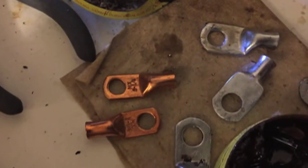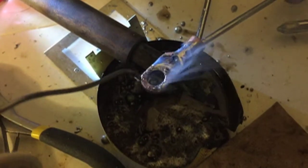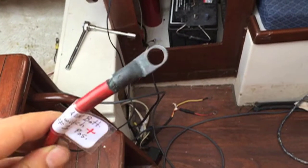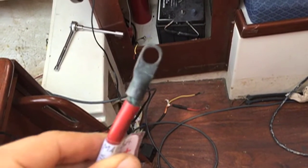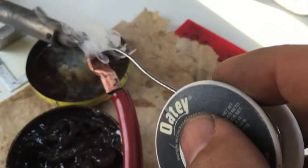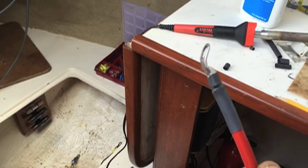I can only find copper connectors, so I'm tinning them myself because we're at the 11th hour and I don't have time to chase down tinned connectors. It's not bad — it went from this to this. There's no reason why you can't tin them yourself. I'm not renewing everything, I'm refurbishing a lot of things. This is the main battery cable going from the inline main switch. I'm going to clean up this copper, tin it, and refurbish it the best I can. Okay, that's perfectly good now.